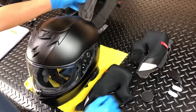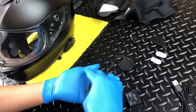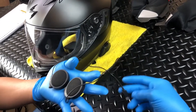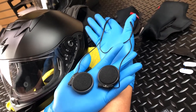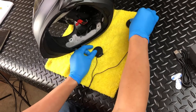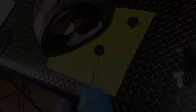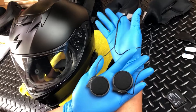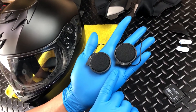If you purchased your helmet in the Exocom pre-installed configuration, please skip this section as the speaker microphones have already been installed. For those who bought the helmet and Exocom separately, now is when you install your speaker microphones. Note that the speaker to be installed closest to the control unit has a shorter speaker wire. You might also have noticed that there is no boom mic — that's because the microphones have been fully integrated into the Exocom speakers.